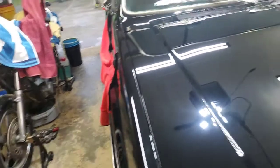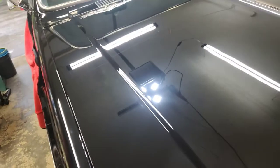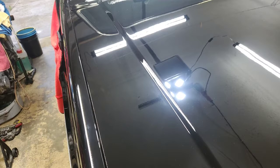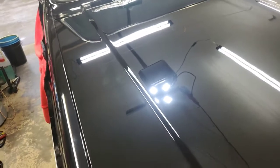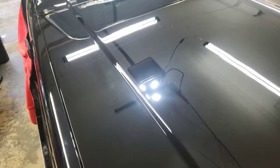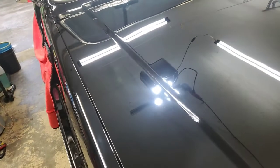But what, 2 days now on the hood of this bad boy Silverado. Lord have mercy. As I showed you guys the other day, a little wet sanding in spots, or damp sanding. Yep, somebody's watching. Hey, Mr. Stancil. A lot of compounding with a wool pad, rotary buffer, and then a lot of final polishing with a Lake Country black pad on a long throw, 15 millimeter long throw pro polisher.